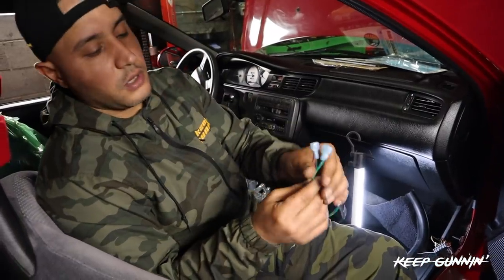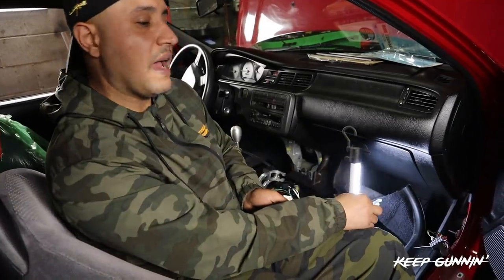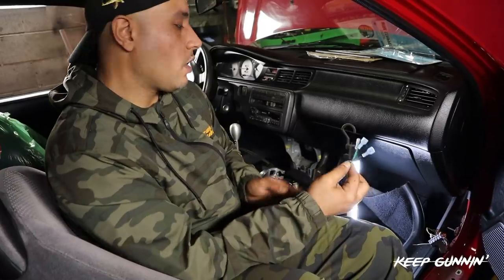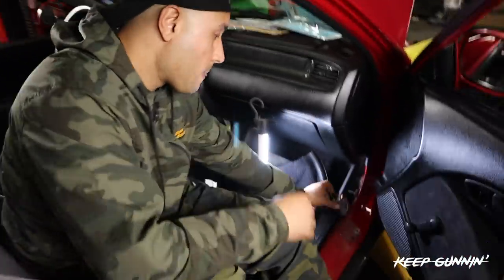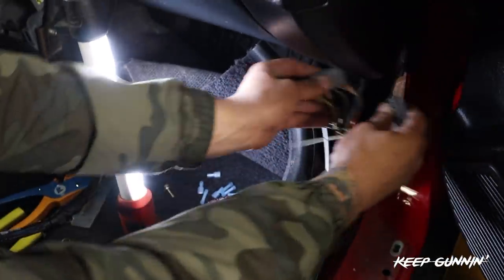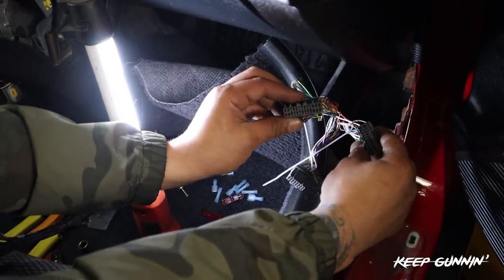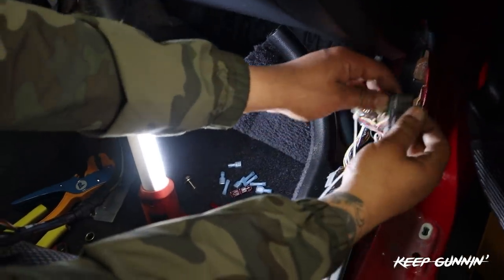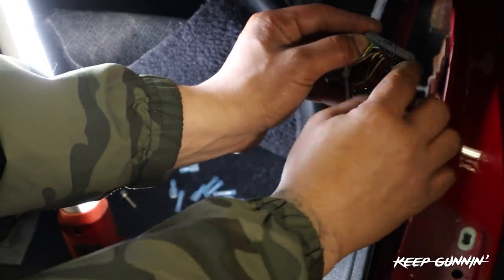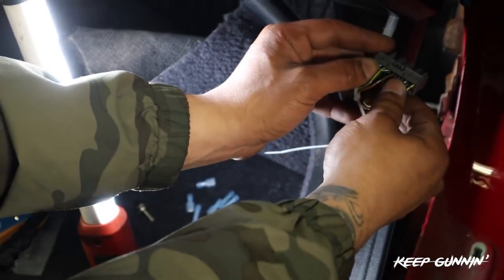All right, guys, so we've got all three connectors on all three wires that we need to pin into the factory harness. So finding the wires, is it gonna be hard? No, we're gonna look at this the simplest way. You have A connector, which is your biggest connector, and you have D, which is your second biggest connector. The other one you don't pay attention to, you don't need it. So when you're looking for your pin, you have this guy facing up and you're looking at the back of the wires. Odd numbers are on the top, even numbers are at the bottom.